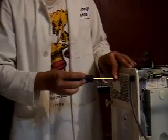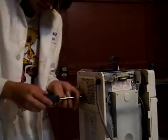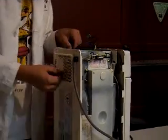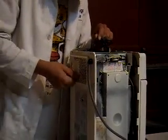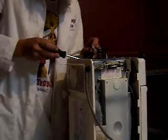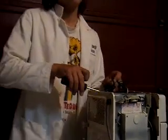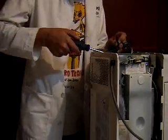The most important thing to know when you're ripping apart a microwave is to discharge the capacitor. Because if the capacitor is charged and you touch it, it will literally really, really hurt — it is possible to kill you, though you probably won't die, but you will be in some pain. The capacitor and rectifier form a voltage multiplying circuit — it doubles the voltage and converts it to DC, or direct current.